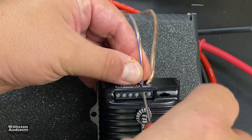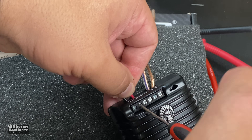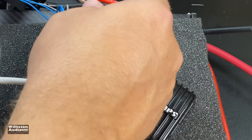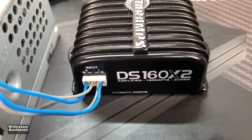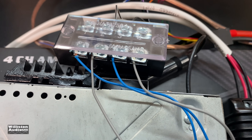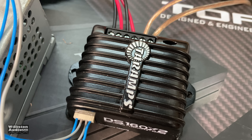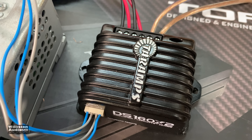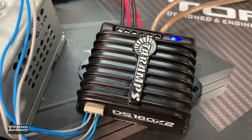So here we are hooking it up. You can see we had to use some small 12-gauge wire for the power and ground, and 16-gauge for the speaker connections. We got it wired up on the bench and hooked in the speaker-level inputs from the Pioneer ADPRS head unit to power it up. The amp has no LED light until it senses music — so let me start the track. There's the LED.